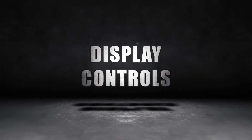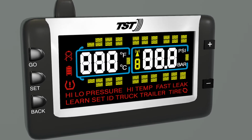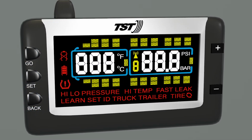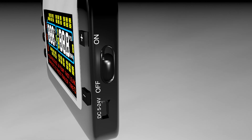Next, we'll review our display controls. There are 5 programming buttons on the display. On the left side of the display are the Go, Set, and Back buttons. On the right of the display are the plus and minus controls. The power slide switch is also located on the right side of the display. Just slide it up to turn on the display, and slide it down to turn off the display.